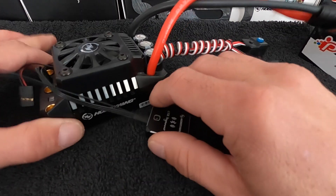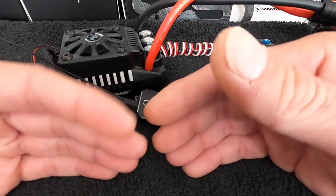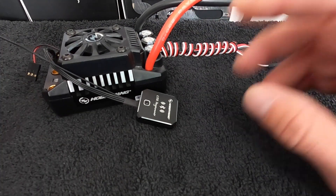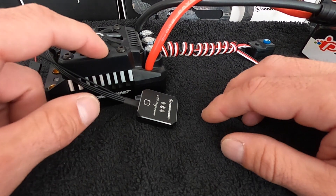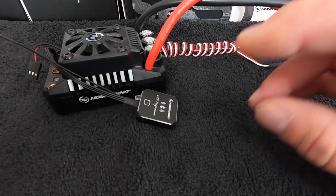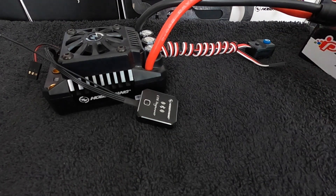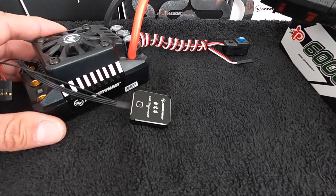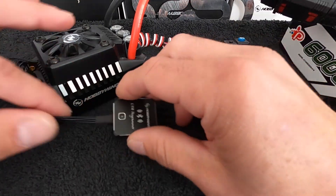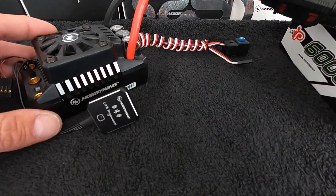This is a Max 5. Connection and usage is pretty much the same for the entire Max series and most of the Xe Run series. The difference is going to be the settings that are available. The Max 5 and Max 6 share the same settings. The 10 and the 8 are a little bit different, so just check the instruction manuals — there are some subtle differences. The Max 8 and Max 10 have more adjustability in the reverse and have some timing settings that the Max 5 and Max 6 do not. The Xe Run series is a completely different set of tuning options. We've done videos on some of these before, so check out the channel.